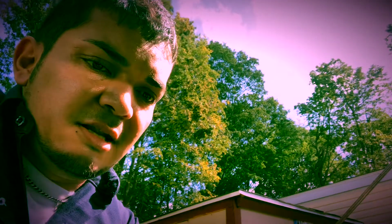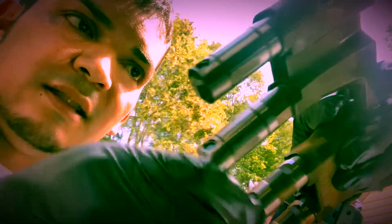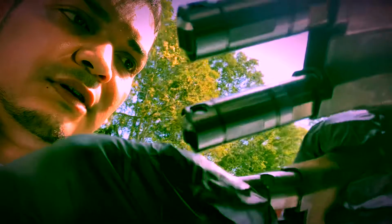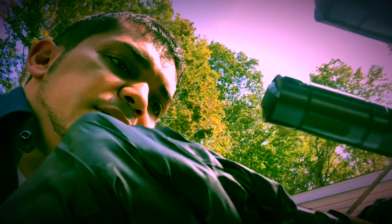Alright guys, so now when putting your lifters back in, always remember, these trays wear out. So make sure yours keeps your lifters held. Because if they wobble and the tray doesn't hold them, they'll flip. And if they flip, there's a roller that rolls against the cam. If this goes sideways, you know what that means. So make sure your trays are always good. They're not expensive. Just replace them.